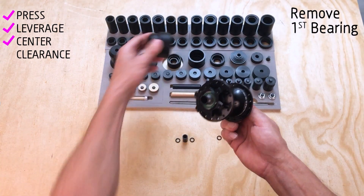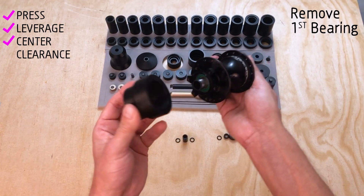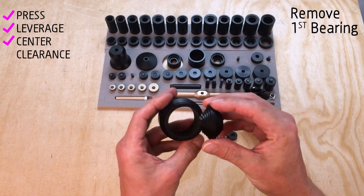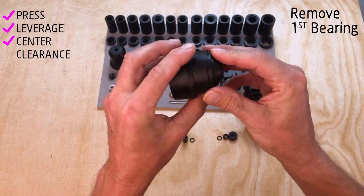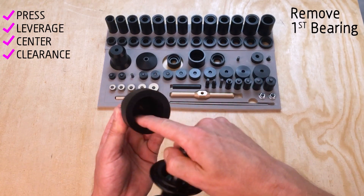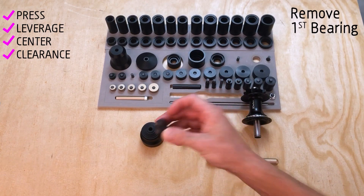For leveraging against the disc brake mount, we'll use the Sleeve 6. You don't need to remove the disc brake rotor - the Sleeve 6 can fit right up against the screw heads. The Sleeve 6 works with the universal step; flip the step over for a tighter fit and always choose the tighter fit. The Sleeve 6 has good clearance space for when the bearing comes out with the axle. Then grab the handle for the pressing side and the stud stop for the other side.